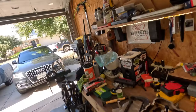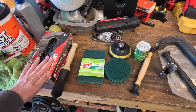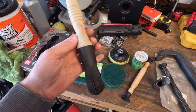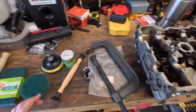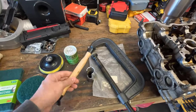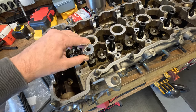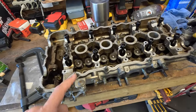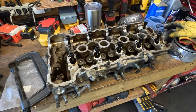We're back home in my garage. Yesterday we got most everything cleaned up on the SR that we could in a solid day's work, but I brought the cylinder head home and I'm going to tear into it and rebuild it here on the workbench. I've got a scrub brush, Scotch-Brite with a drill attachment, valve lapping compound, a valve lapping tool, and a socket to compress the springs so I can take the keepers out and pop the valves out. I want to completely disassemble this head, get it super cleaned up, lap the valves, and get it fully reassembled.